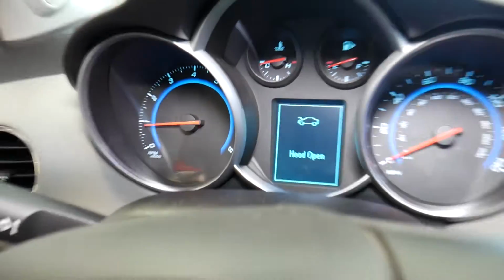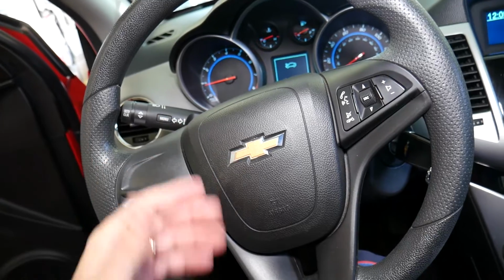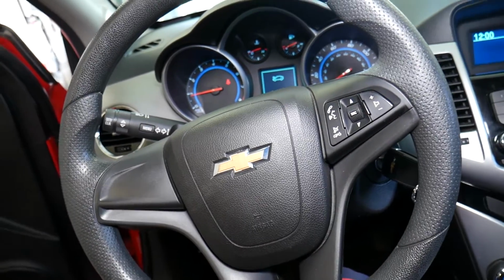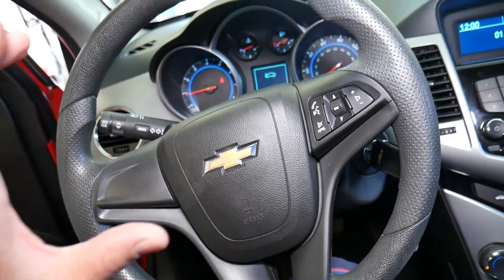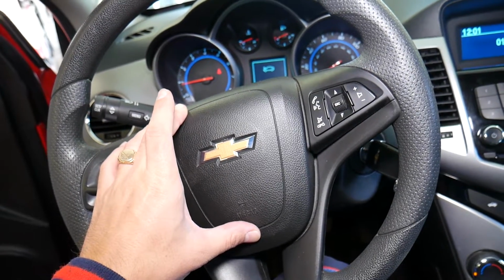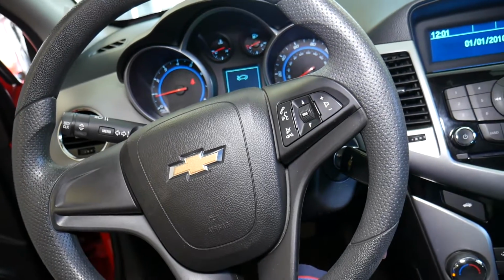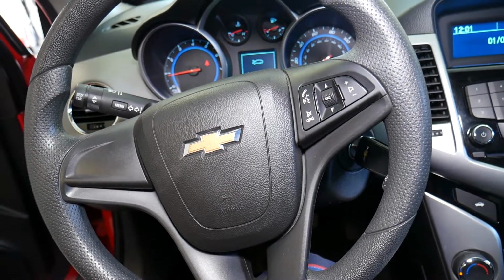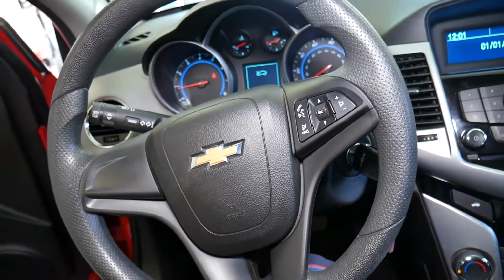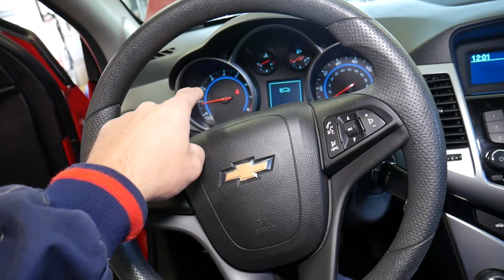Let me explain to you what I'm talking about. Chevy, GMC, Buick, Cadillac, most of them, especially the ones we've worked on probably past 2008-9, because the Chevy Cruze started that generation in 2008 worldwide. The things we've worked on, we noticed that the airbag system is self-healing. What that means is that if you find a problem and you fix it, the airbag light will turn off on its own.